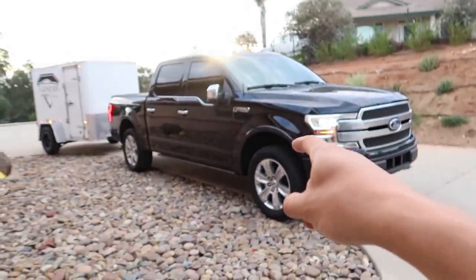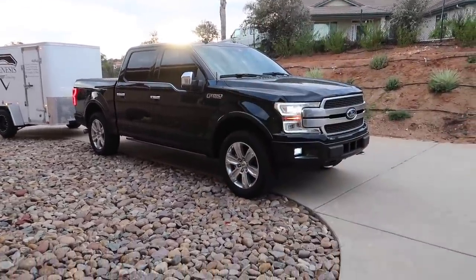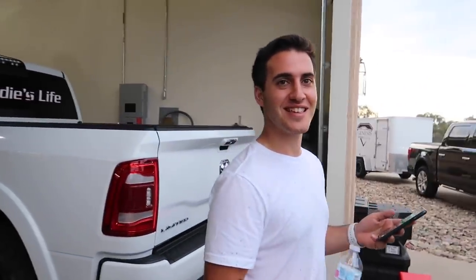If you're just looking for a horn and not using onboard air, a single compressor is fine. But if you want onboard air, I highly recommend dual compressors — you're going to enjoy it a lot more. My friend Martin has one compressor and hates it because it takes forever. I filled this tire up in under a minute, which means even going from zero to 80 pounds you're done in under 10 minutes. When we aired up at Glamis with a single Vi-air it was about five minutes per tire — a nightmare.